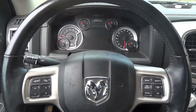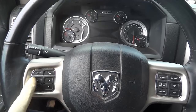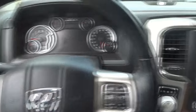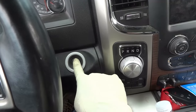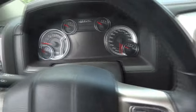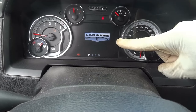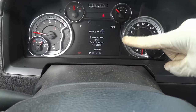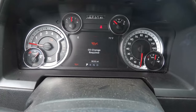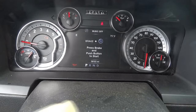The first thing we're going to do is turn the key on, and we will be using these buttons here on the left side of the steering wheel. This is a push button so I'm going to push this button twice so we can get on accessory mode. Our key is on and the oil change light should display there — oil change required. That's the light we need to reset.